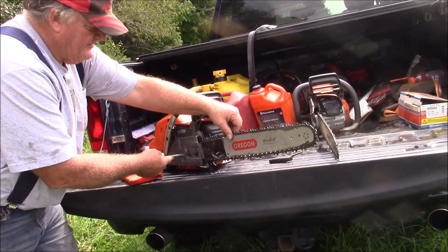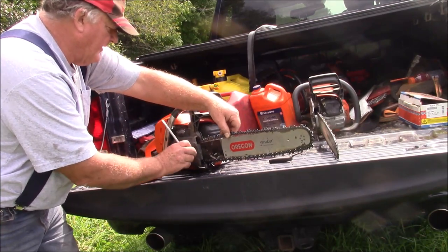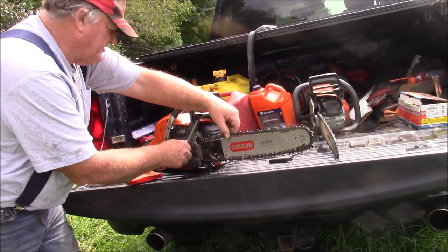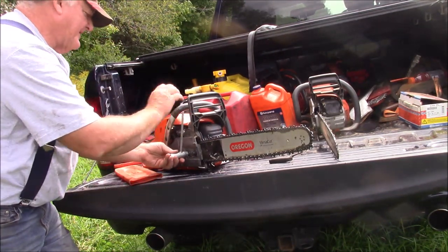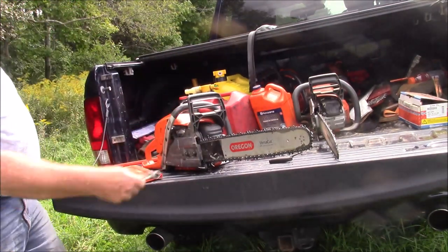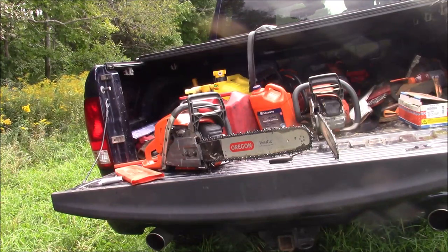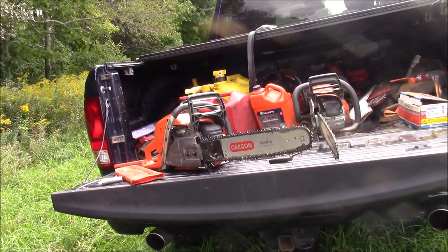And, you know, it's easier on my back because I'm working on the ground often, or working pretty low to the ground, and it's easier to work in the brush where I have to work around tight spaces where there's other trees and things like that in the mix. I think it's easier on the saw because when I get stuck or something like that, I don't have the long leverage working on the case. It's lightweight, it's handy, more available power to cut versus when I get into the mud, it takes less time to sharpen a chain because there's less teeth to sharpen, 72 versus 84 or 93. But the lightweight factor, the handy factor, those are the ones that really bring me back to the 20-inch bar for my applications, you know. And I'm not doing this just talking out of my ass.